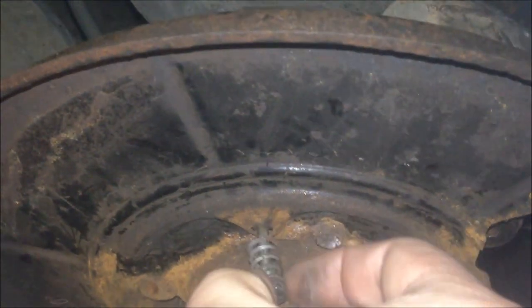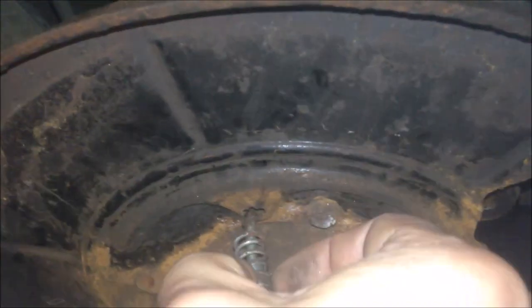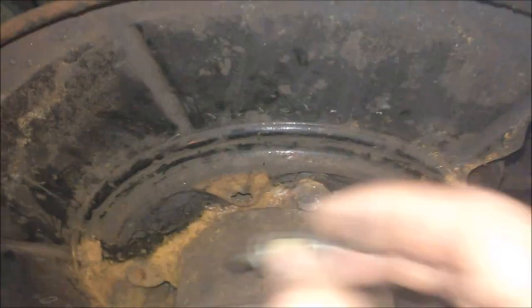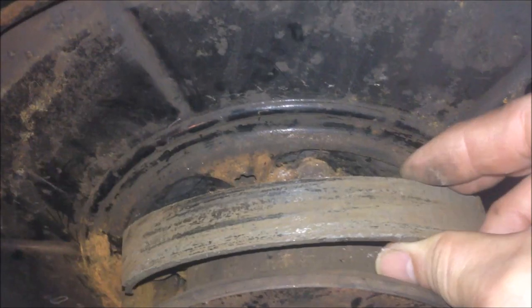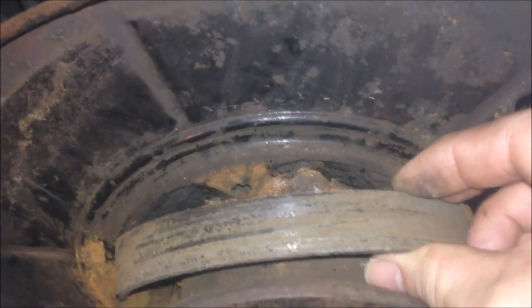This hole had enlarged, and the pin just pulled out. The pin and the spring dropped somewhere around here. And the brake shoes — when I opened it, they were just like this. So it produced the grinding noises.